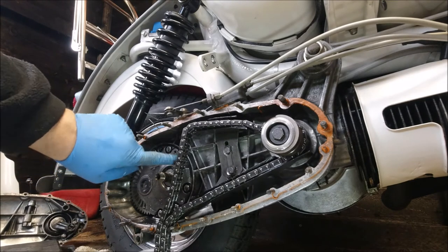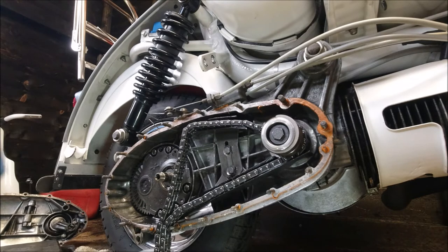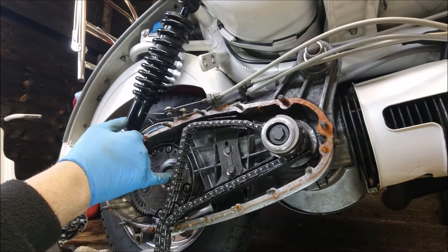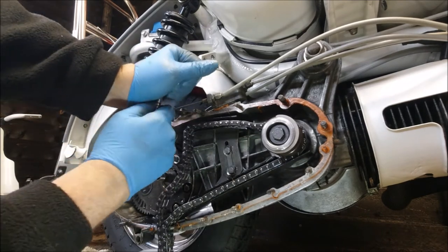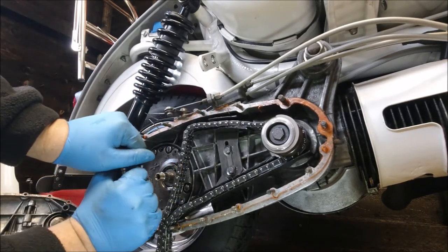What I'm just going to do now is go over and make sure these are nice and tight. While we've got the engine apart, it's just prudent to do so. Peace of mind and all that. They don't look loose. And again, you can tighten these to, what, 14, maybe 15 pounds, if you want to. I just think that a lot of people talk them up and they strip the threads. I think you're better to do it by feel. But that's my own. See, that's rock solid. Perfect. I'd say that's been built 2 years now, that engine, and that is rock solid.